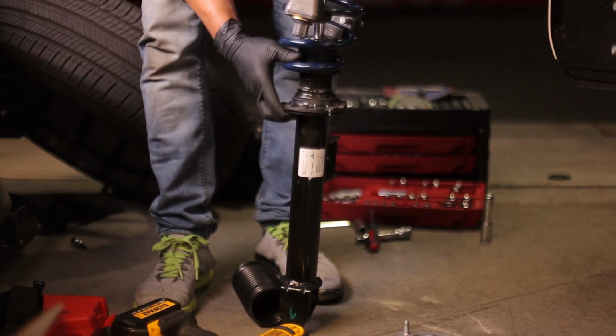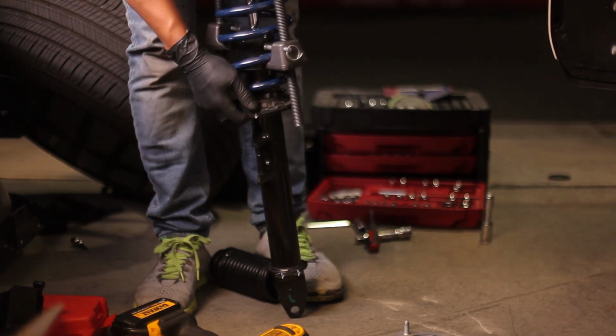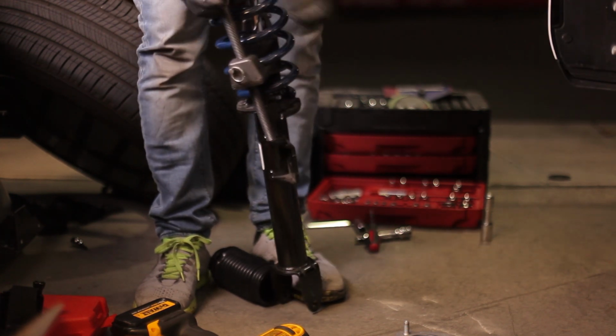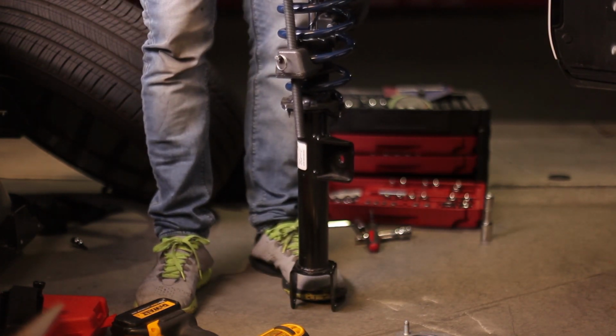Using the spring compressor from AutoZone was impossible, as it would jam up with the compressed coil due to the lowering spring having a tighter gap between coils. I finally gave up with the spring compressor, and my camera also ran out of battery, so I apologize that I started relying on my GoPro, head mount, and iPhone to document the process.